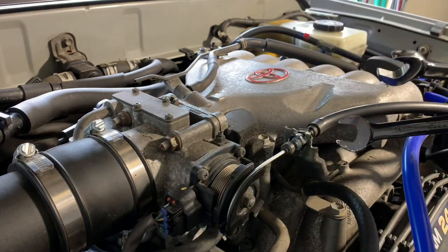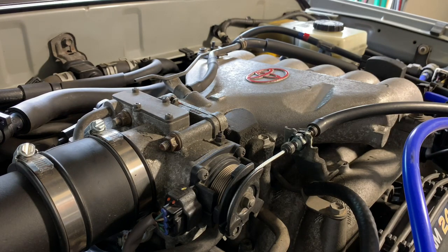We're going to loosen this up and back that off just a little bit so you don't have as much play in the cable. Another thing you can do is have the engine running while you're doing this so you don't overdo it — you don't want too high of an idle. Recommended idle speeds are right around 550 to 700 RPM when it is fully warmed up and idling correctly.